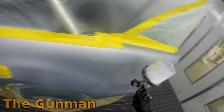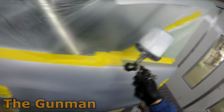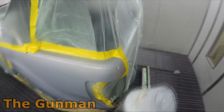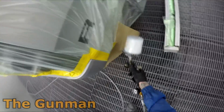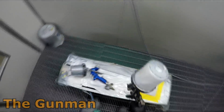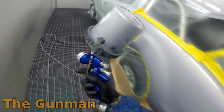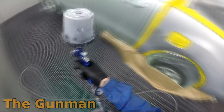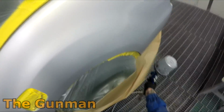So first up, I'm doing the base coat blender over this blend section of this quarter panel. Now usually I would actually have brought the color right up to that curve, and this curve down the bottom here, and that way you've got your color over most of the panel, and it's going to be a good area to not see a blend. But as much as anything, I wanted to prove to myself that I can do blends on big flat panels.